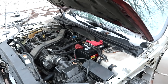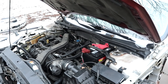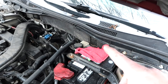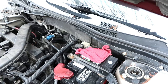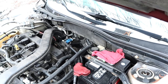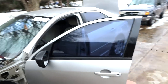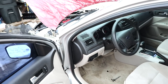This probably goes without saying, but anytime you're going to work on any electrical component on your car — but especially the airbag system — you want to make sure you unhook the negative terminal on your battery first. I have already unhooked the negative terminal and tucked it back behind the battery, and then I placed a rag up here so that the terminal and the negative harness cannot make contact and accidentally re-energize the system. Now that the battery is unhooked and has been for a little while, I'm going to show you how to find and unhook the SRS module, the little computer system.